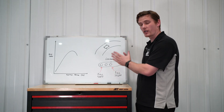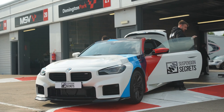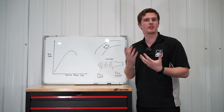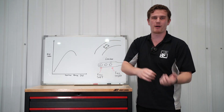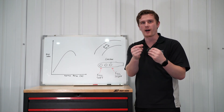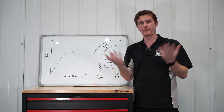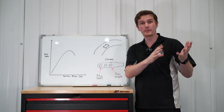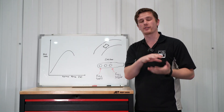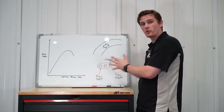In this case, we're going to be talking about cars that are already set up to an extent, such as the GT4, a BMW M car, or a Golf GTI, where the roll bars are working well and the chassis is relatively flat through corners. We're tuning the car for track and race behavior. This distinction matters because in some cases stiffer anti-roll bars will fix an issue, but for a sports car, going stiffer could make that issue worse.